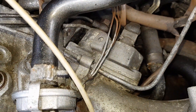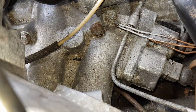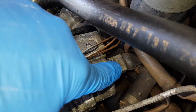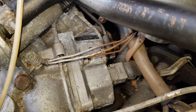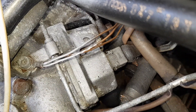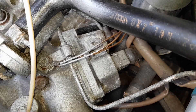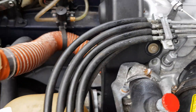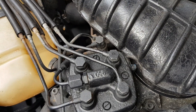The warm-up regulator is attached to the air manifold. It has an electrical connector and, at the back, two fuel pipes connected to the unit itself. That is how this unit regulates the pressure of the fuel system — whether it's a cold start, running warm, or general conditions when you ask for more power. Those fuel pipes go along to the fuel distributor, and the pipes feed back to the fuel tank depending on the pressure required.